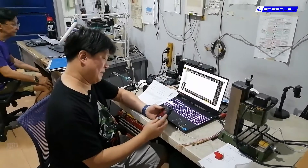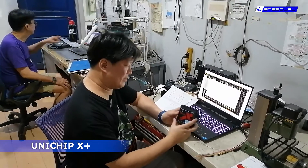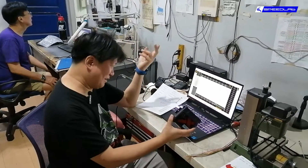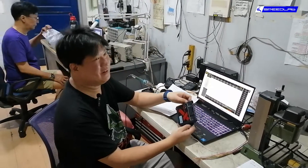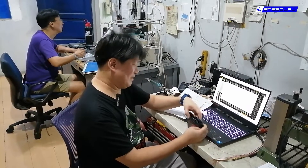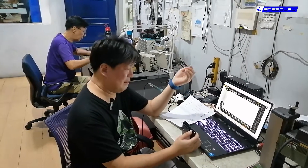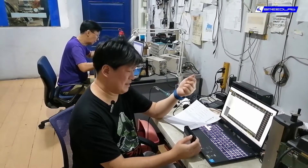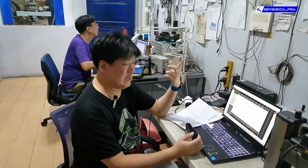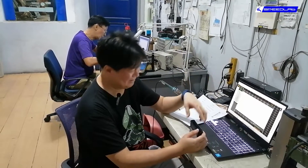This is the Unichip X Plus, the latest version of the Unichip. If you browse the internet, especially on Facebook Marketplace looking for a used one, you will come across the Q, Q+, and Q4 versions. Those will still work, but the latest one has features the older ones don't — particularly throttle control and the ability to drive other things like injector solenoid, boost solenoid, and nitro solenoid.